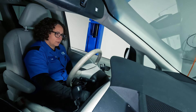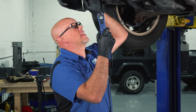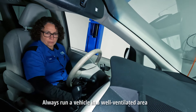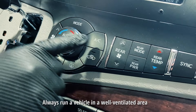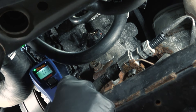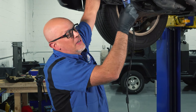That is the connector we want to see power going to when someone turns the AC on and pushes that button — there should be 12 volts there. I have Sue in the vehicle. She's going to start it up, toggle the AC button on and off, and I'm going to check for power at that connector. We have it disconnected. Go ahead, Sue, start it up. AC on. And with the AC on and off, we're not getting anything. There's no power at that connector, which there should be.